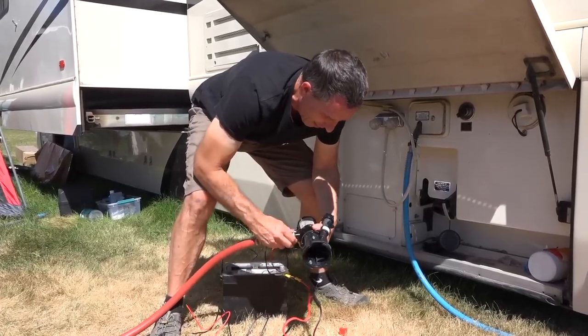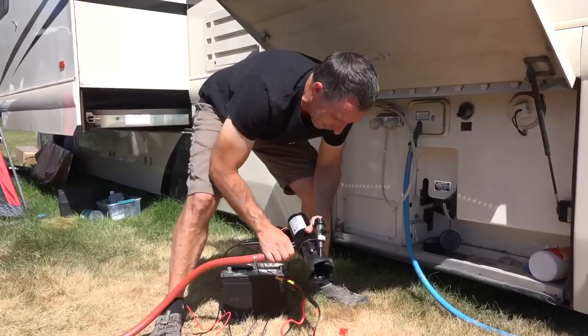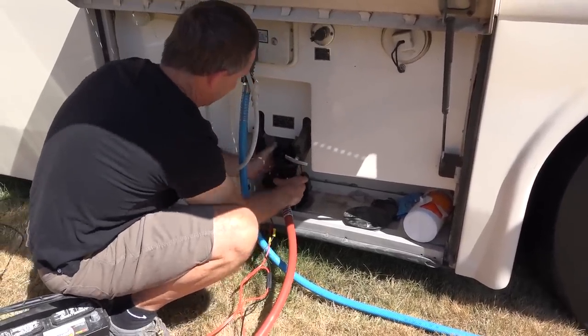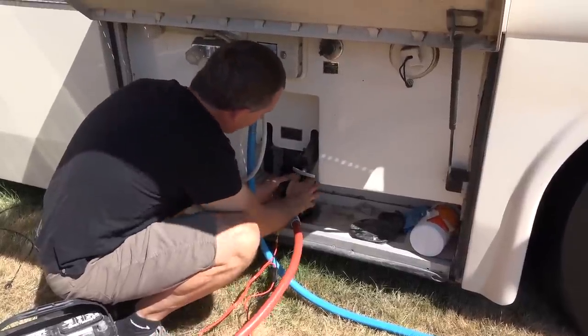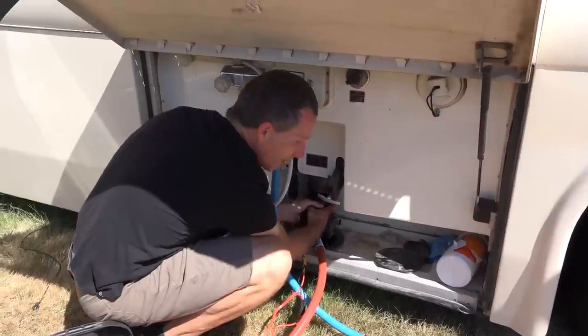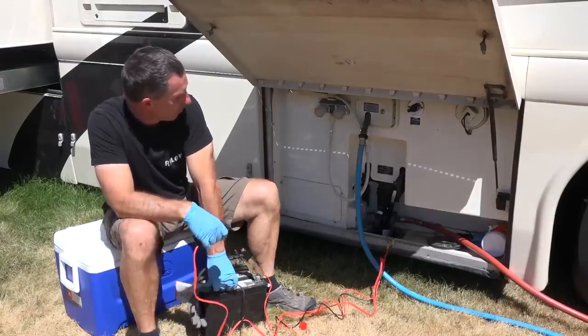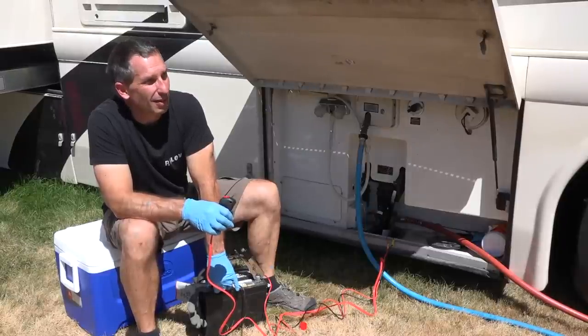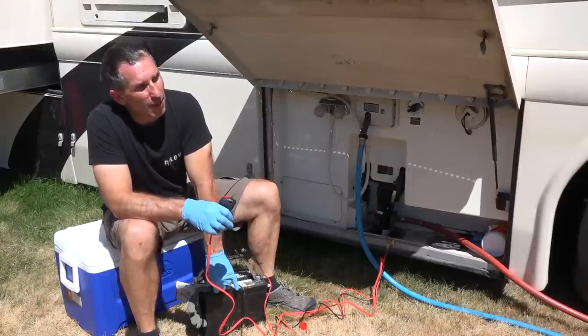It's super easy to maintain — there are very few moving parts. You can disassemble it and replace parts if you're going to be using this a lot. They do recommend that you not permanently attach it to the RV; it's meant to be attached only when being used. You do want to pay attention while doing this because you don't want the pump to run dry for more than 30 seconds, and it only takes a few minutes to empty the tank. You don't want to just pull a valve, turn it on, and walk away — you want to be involved so you don't do any damage to the pump.